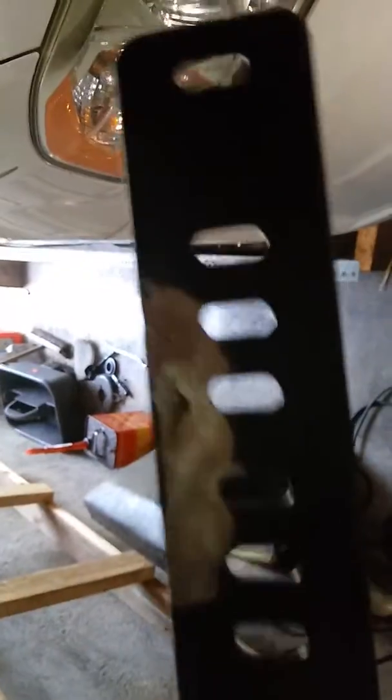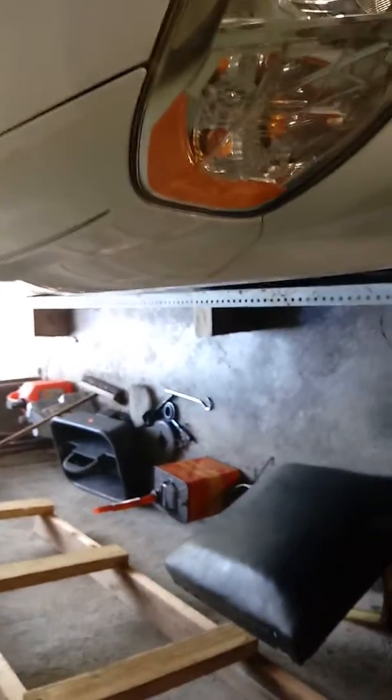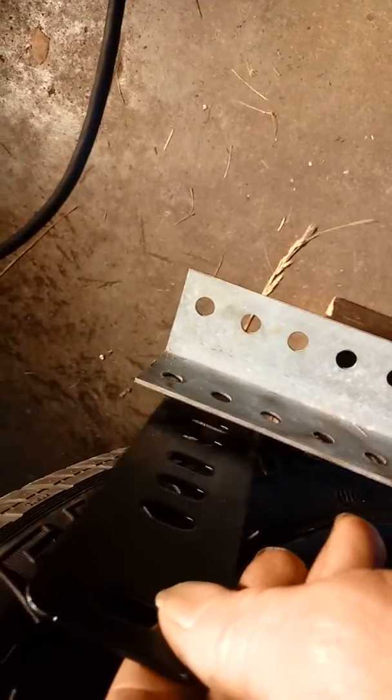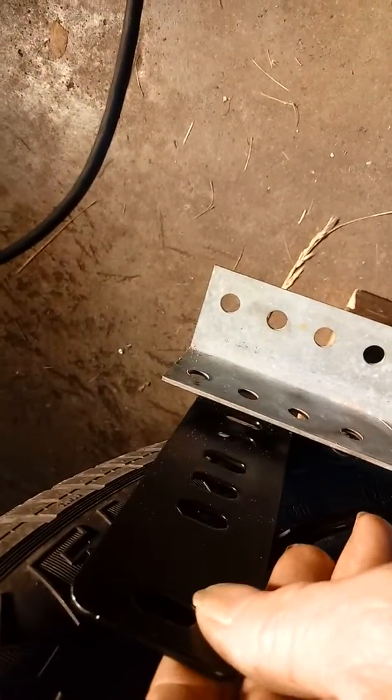Okay, now once I set her down, I bounced her a little bit just to get her to settle, and she's down. Now, for the gauge I showed you earlier, this part of my bed frame, well, she's 125 thou or 1/8 inch. You want an 1/8 inch toe in, to help keep your vehicle going straight, as long as everything else works. And just an example, here's how this goes in between. Let me get a better light here for you. Give me a sec. Okay. You want this to fit just snug, like it's a glorified feeler gauge, what a setup is. You want just a snug 1/8 inch in between.